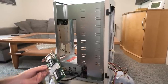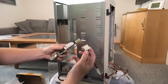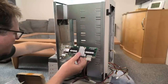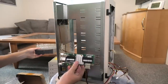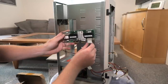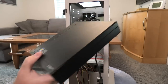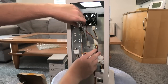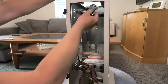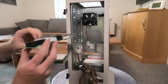We're not going to get much further with this project today. You can see how this card comes in handy — it pops right into these Molex connections, and that replaces the other unit. It kind of does the job of this box, except it gives us SAS connections instead of network connections. I could have put a small computer in here instead, maybe even placed the tiny Lenovo as part of it. I'm going to make it into a DAS and put this thing in here somewhere — maybe on top, pointing backwards so the connections come out that way.